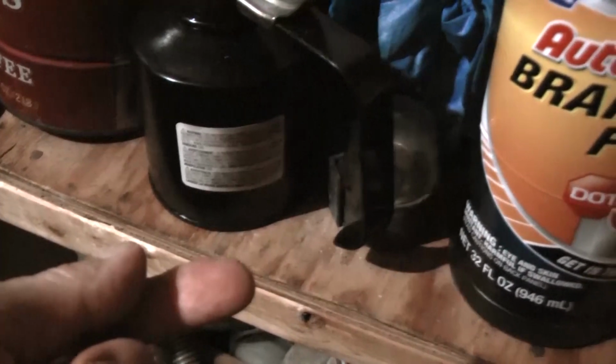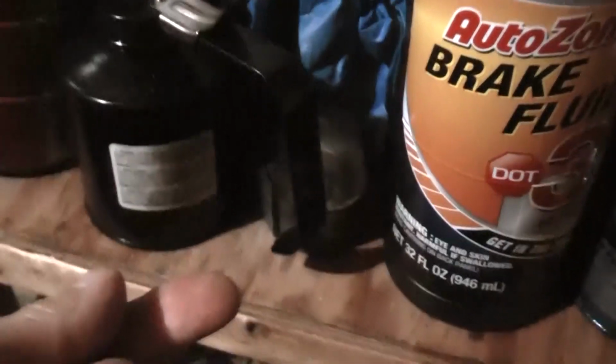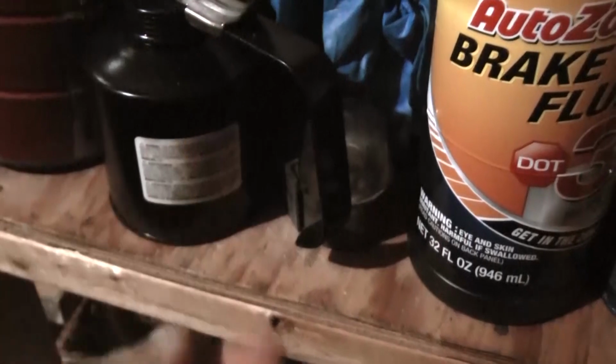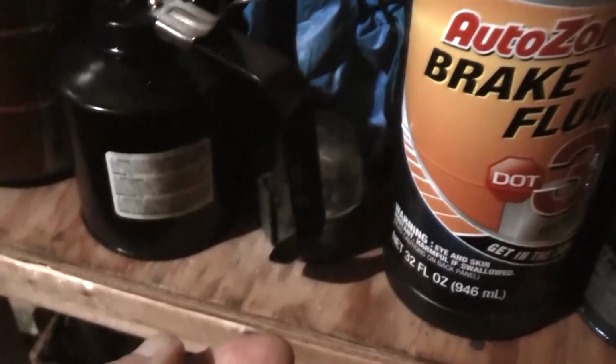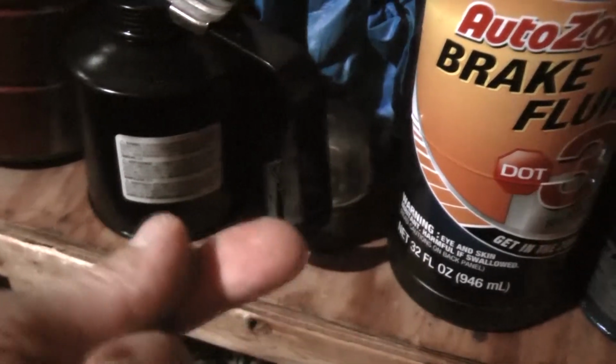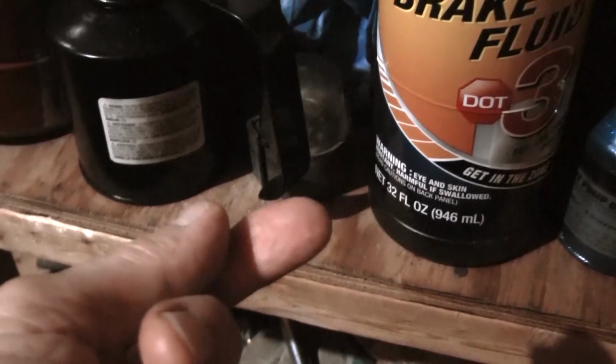I went back and forth with the plunger, like the clutch, with my hand over it until I felt a good suction, like it going out and in, out and in, and squirting out brake fluid. You got to put your hand over it to get a suction on it, I guess so it knocks out the air. And then I hurried up and ran it over to the truck and put it in the truck, and I made sure the reservoir stayed full and never got empty.